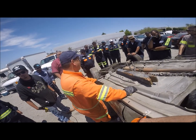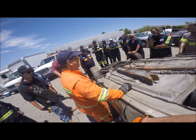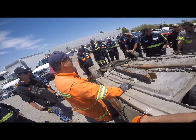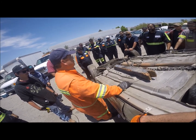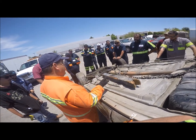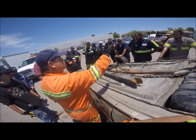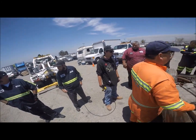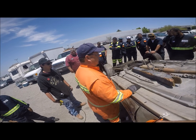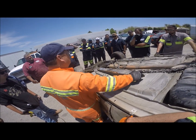And on a mechanically operated boom, to raise and lower the boom, you had to get a hand crank out and crank the boom up and down. Now you guys don't have to do that. All you have to do is hit a hydraulic control and elevate your boom. So you don't really need one of these, because if you have a car that starts to slide, all you have to do is elevate the boom usually. If you elevate the boom, you're going to start to get lift on that side and you can get it to roll. But in the days when we didn't have the ability to hydraulically raise the booms, it was quicker and easier to use one of these rollover stiff legs.